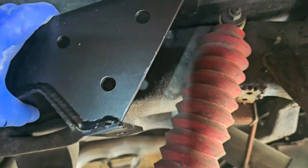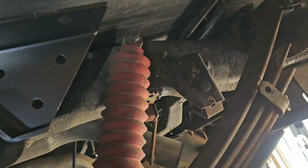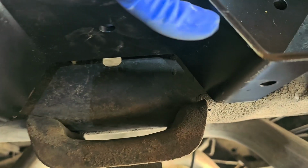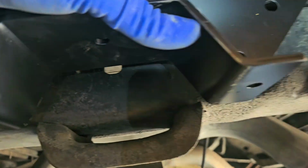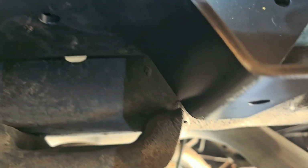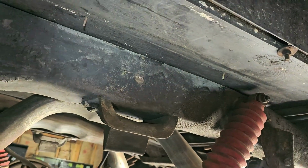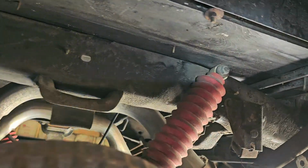Use a marker. Now, if you turn this around, it's super easy. The only piece you have to mark out is the center hump. Make sure you leave yourself maybe 1/16 to 1/8 inch in this area in the center. Other than that, I use a plasma cutter. You can use a cutoff, whatever you prefer. It all ends up in the same place.